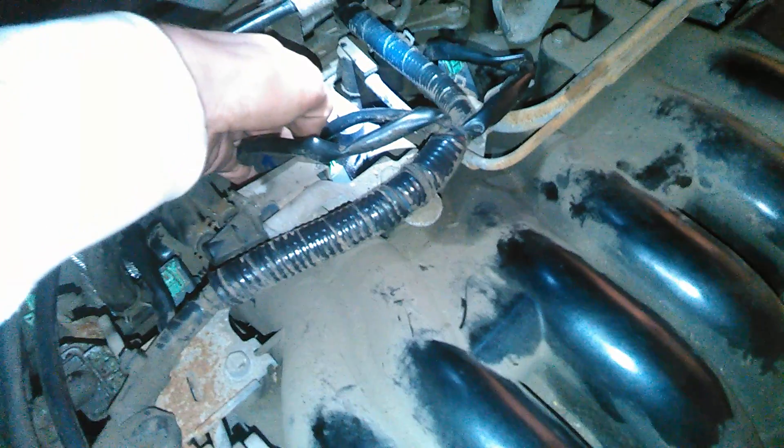See how it drops, and when I plug it back in it comes back up. Anyways, you heard the engine drop. It'll be a noticeable drop — it won't be idle speed changing because the engine's warming up or anything, it'll be a noticeable drop and the engine will run rougher, especially down at these idle speeds.